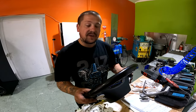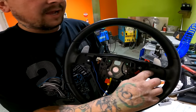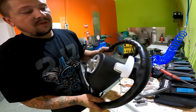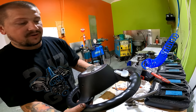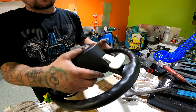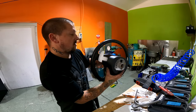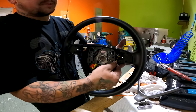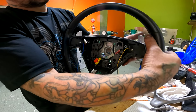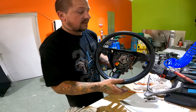We have finished up the install of both shifters - the up and the down. Both sides have an M5 on either side and we've got the wires coming out - drilled through as well. From the back side they've actually turned out all right. There's a tiny little air gap underneath but we've got ways to get around that. Now we need to wire it up - the original wiring goes to the up and down buttons on both sides. We're doing up on this side and down on this side.